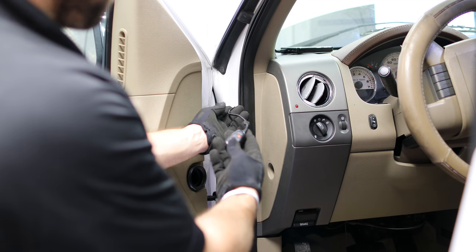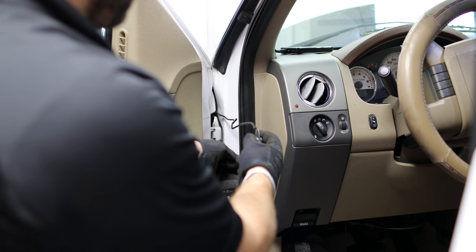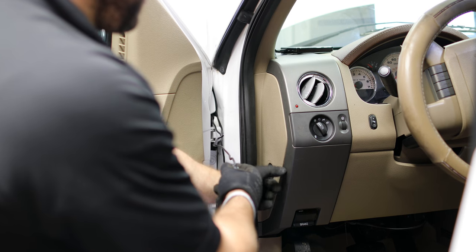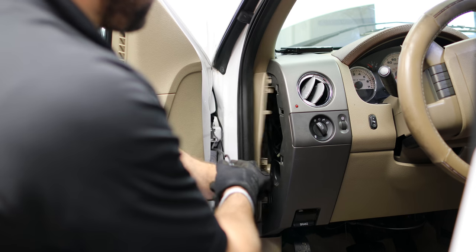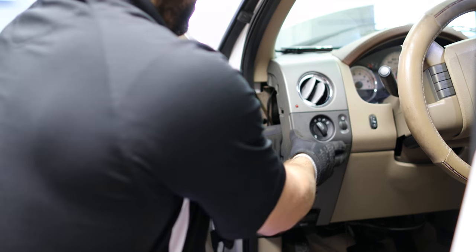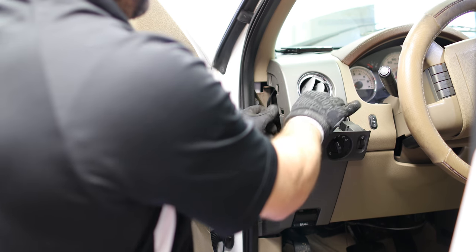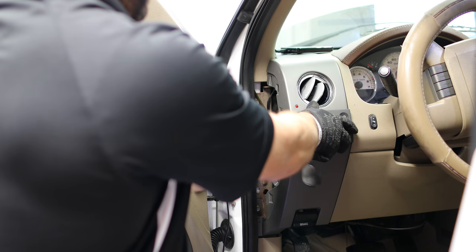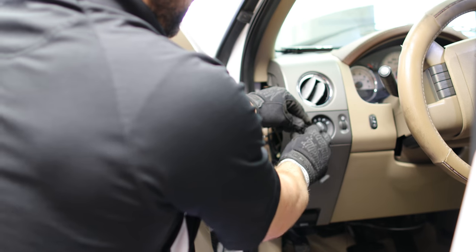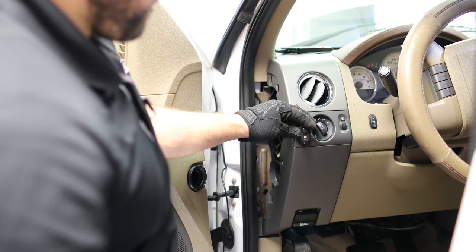This is what our harness looks like coming from the engine bay. We want to get it into the dash area and mount the switch here, though you can mount it wherever you'd like. Pull up on this rubber grommet to pop it free from the door jamb, then take your finger into this AC air port and pull directly out on the side dash piece. Run the switch up under the rubber grommet and apply pressure on the headlight switch panel — it'll pop directly out, allowing you to run the switch up under it. Put the panel back on, bring the switch up and mount it to the dash, reinstall the side panel, and push the rubber grommet back into place.